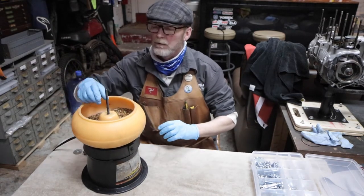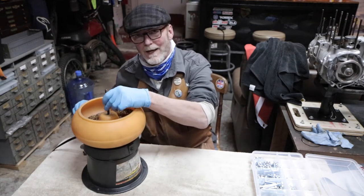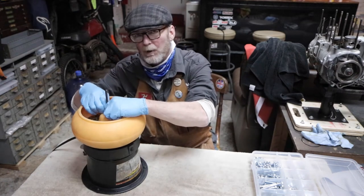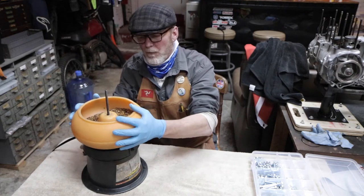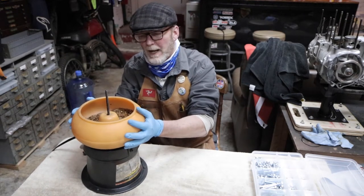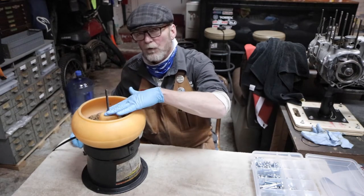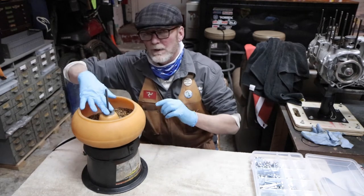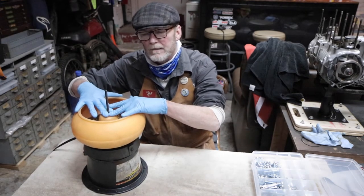so that when you put the fender washer and washer stack and the wing nut down on here and tighten this up all the way, you can tighten it up a little bit more without deforming the bowl. So the bowl still rests on the rubber pads that impart the shake, but you've created that support on its underside so that you can squeeze down more when you bolt that in place.